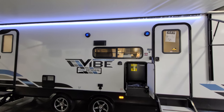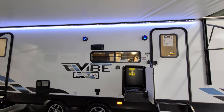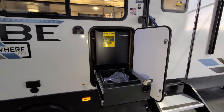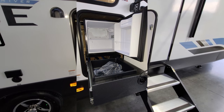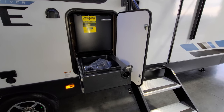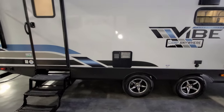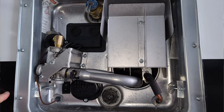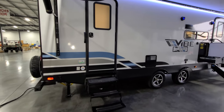There are two outdoor speakers, and those outdoor speakers now work off the TV with the FM radio built in. Just above the window is your stove exhaust with a little flapper you have to open. There's a little electric mini fridge — strictly electric, no propane or 12-volt, so you do have to be plugged in to use it. There's a dump sink and a cold water spray port. Behind that little black square is your six-gallon water heater — the lower center has the drain plug, lower left is the on/off switch for electric, and up top is the pressure relief valve — remember to relieve the pressure before draining.